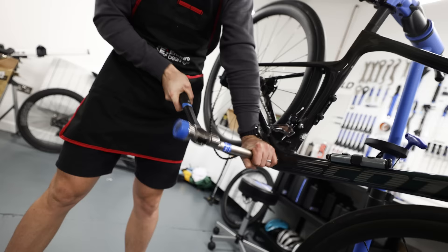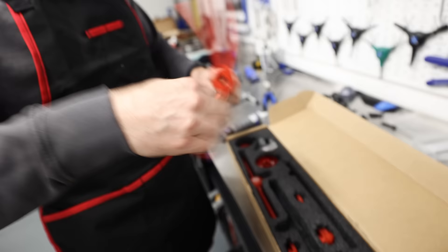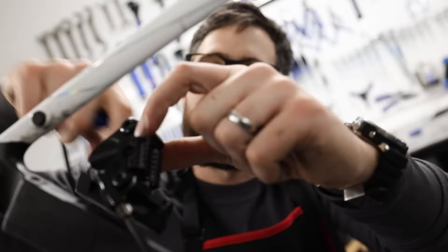The chainring going on the bike is a Cenix, also from AliExpress — taken off another bike to make this build as AliExpress as possible, and it's served well so far. The wheels present an issue: the mounting holes haven't been drilled straight and don't line up properly. They'll need to Dremel the holes bigger because they're too narrow — you can get one bolt in but the other goes skewed.